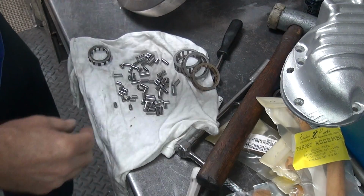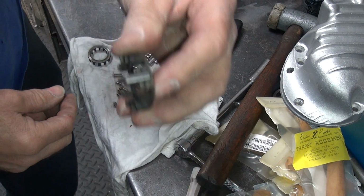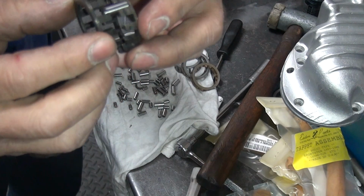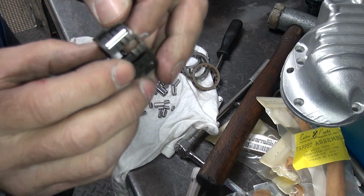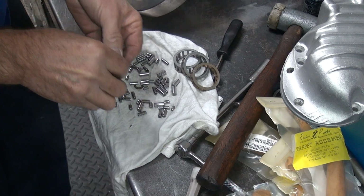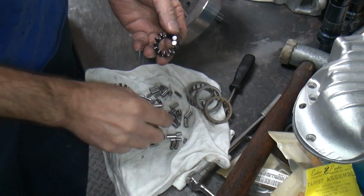Okay, now these short cages take long rollers. So you stick way up. They stick up a long way. See the roller? But it takes 2 cages. Boom. Now it goes together. And you got clearance in here. That means the roller is not locked up. That means you're good. Once again, if the rollers are locked up, then that's a bad sign.